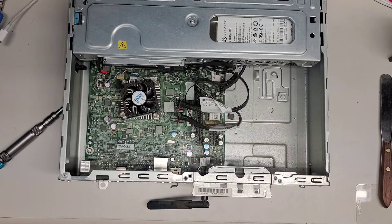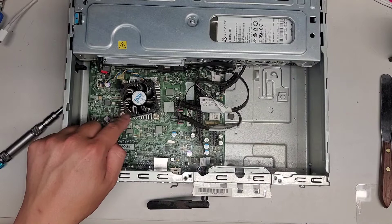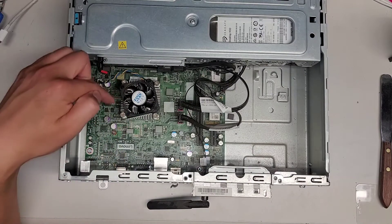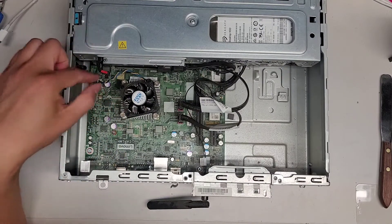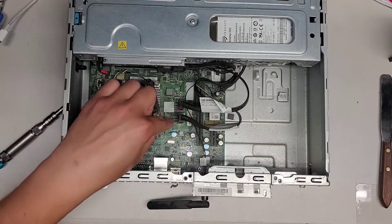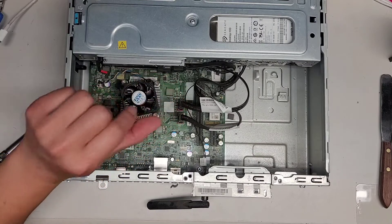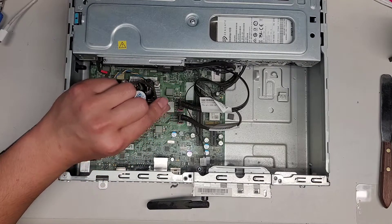This one is having a bad hard drive, so we're going to be replacing it with an SSD. Here you can see there's the fan for the CPU — I believe the CPU is soldered to this board. There's the fan connector here, just like any other desktop fan connector, you just pull it out. The hard drive and CD drive connectors have these little metal clips that you have to squeeze to pull out.